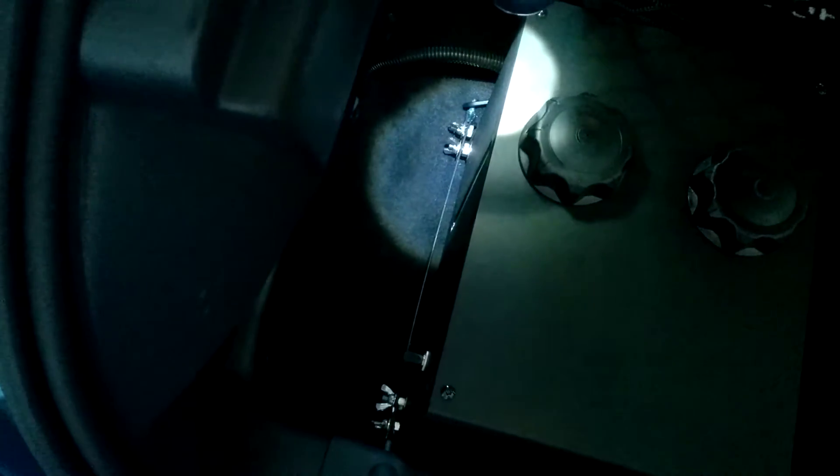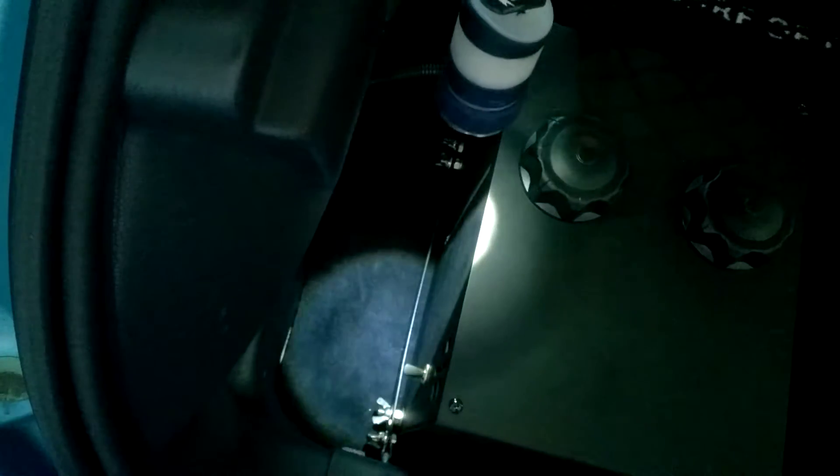In order to bolt this down and keep it steady, I built a little bracket that goes between the luggage tie-downs in the back. I put wing nuts both on the bracket and also on the side of the pump and tank enclosure, so that if I was out without tools and needed to remove it to get at the battery, I could just take the wing nuts off.